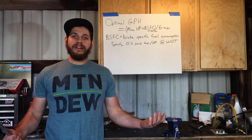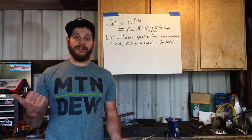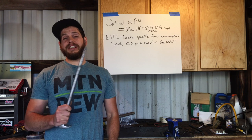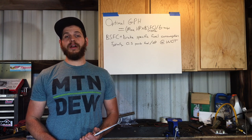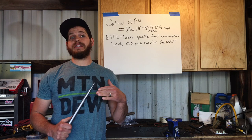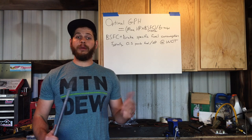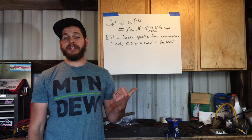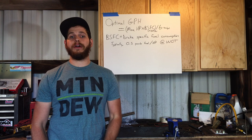How do you know what type of fuel pump you should get? First off, do you have fuel injection or a carburetor? If you have fuel injection, you do not want to use the pump in this video. You're going to need one with higher PSI, higher pressure, because you need that pressure to atomize the fuel through the injectors. I have a carburetor, so I need the lower PSI. This particular pump is 4 to 7 PSI, which is perfect for my Holley carburetor.